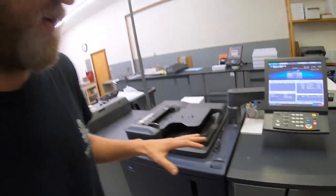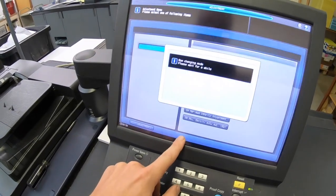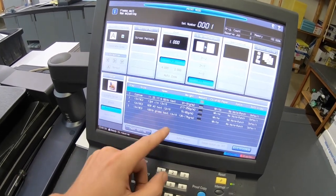I'm warming up the 3070 and need to print some heavy paper and book covers today. I want to go over how to determine what part needs to be replaced on a digital printer. To figure that out you need to know how all the parts work together to put the toner on the paper, and then work in reverse to narrow down what part needs to be replaced. First I need to print out a balance adjustment chart.